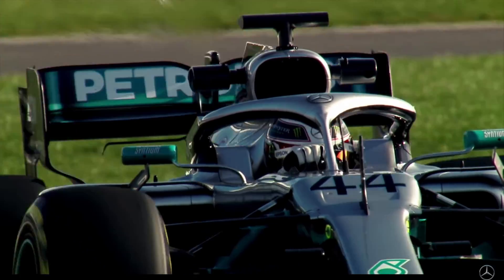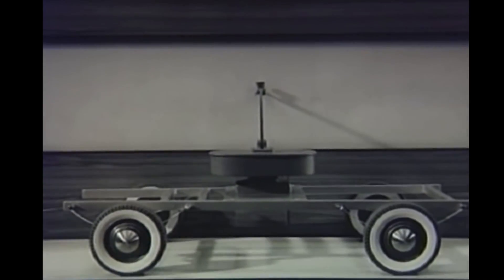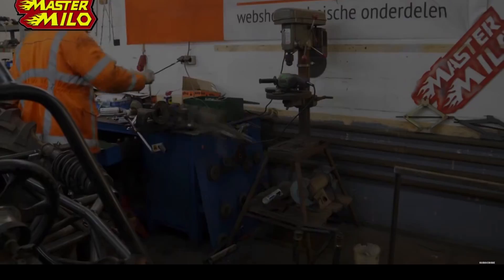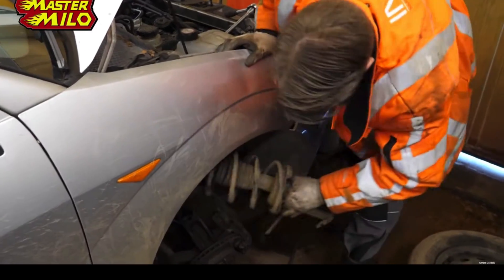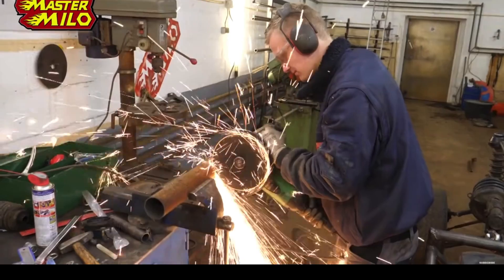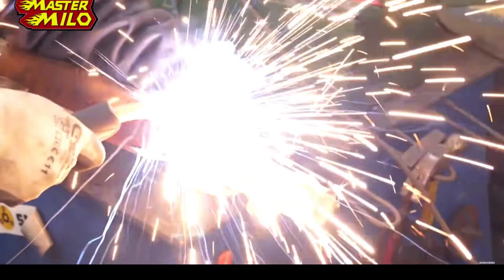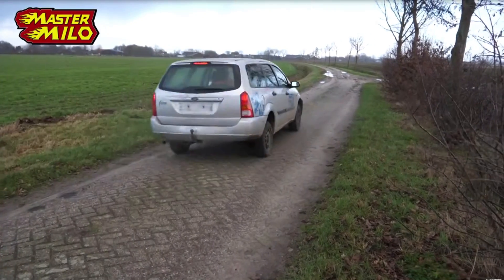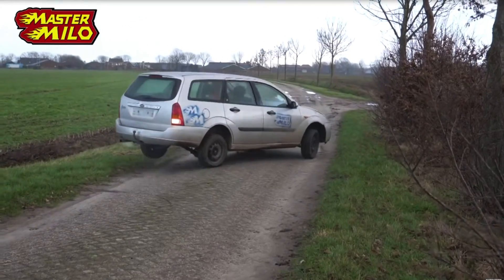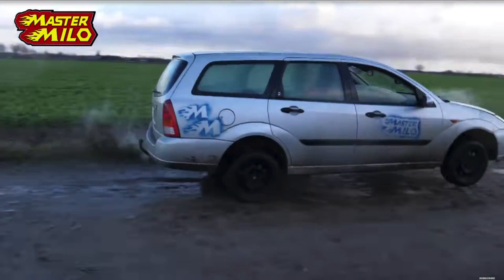Let's take a step back and think about this. Imagine a car that's connected to its wheels with rigid axles only — no springs, no dampers, just rigid axles. This guy called Master Milo made an experiment like this. He took the suspension systems off in this footage and replaced it with rigid axles. In smooth surfaces, this connection should do fine, but when encountered bumps, the car will be kicked up and down violently.